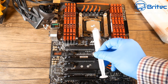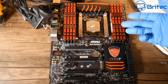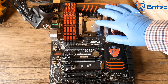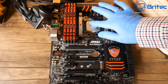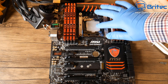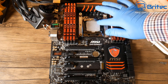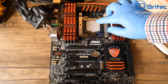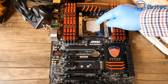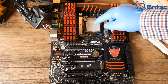There are plenty of people on the internet writing articles saying this is the right method, this is the wrong method. You can see now that it's slightly off center. If I was using the spot method that would be wrong because it's off center - you want to try and get it dead center so it spreads out nice and evenly. I'll do the spread method first and smooth it out. You can either use a card or a glove. Kerry Holzman uses a glove to spread his thermal compound, and I've used the spread method myself on occasion. I normally use either the spread method or the spot in the middle.